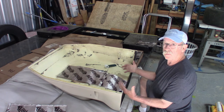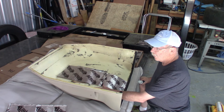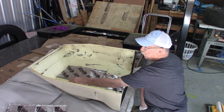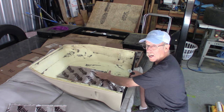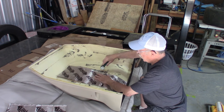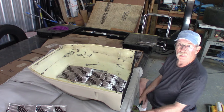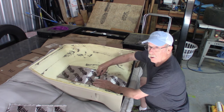What we've noticed so far is it sticks down pretty good if you use this roller. I didn't really clean the old adhesive goo off the inside because it's sticky too, so sticky on sticky seems like a good deal - and it's really sticking down well. They say to not peel the paper backing off the whole way, just a little bit at a time, smooth it down with your hand, then roll it. The rolling really gets it down in the grooves. Because it's warm today - probably 70 degrees - you don't really need a heat gun.